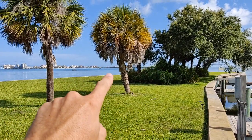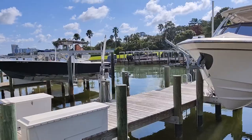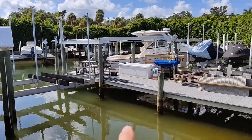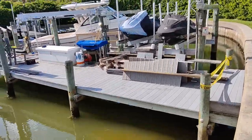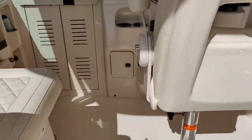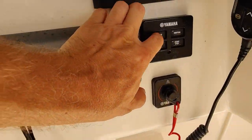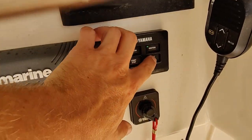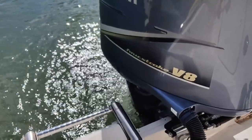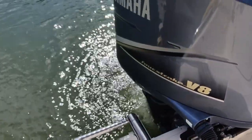We're out at our little marina here, there's our bridge right there. We have another Grady White — I think behind it here we have one of our customers. There she is, our boat's right here. We just started putting it down, let's get on it and fire it up. Batteries are on, we're plenty low enough in the water, let's fire them up and see what happens. I doubt we have a water pump problem — probably just crap stuck in them because this boat's been sitting around. Neither one of our motors are peeing here. Let's rev them up — sometimes that'll draw the water and push out whatever's in there.